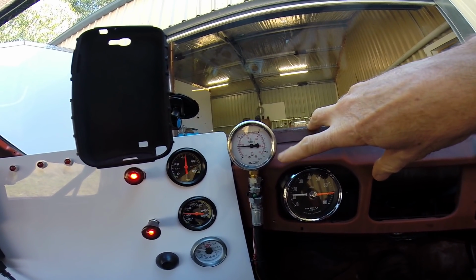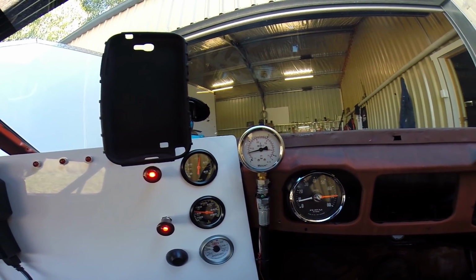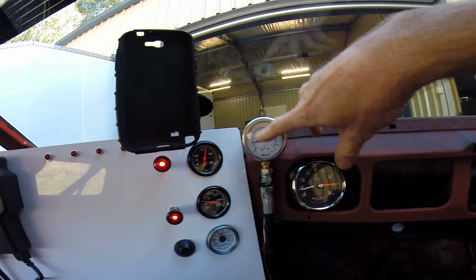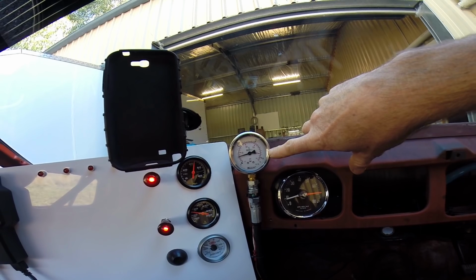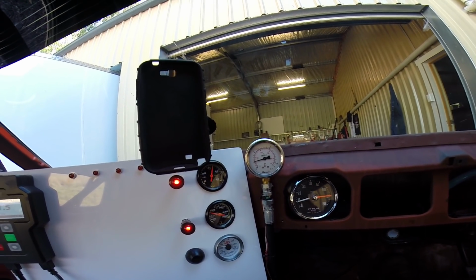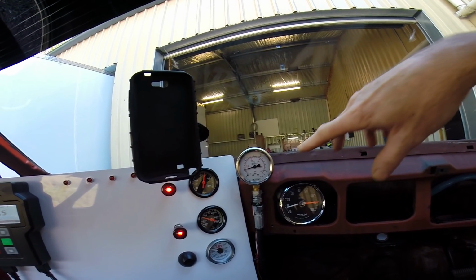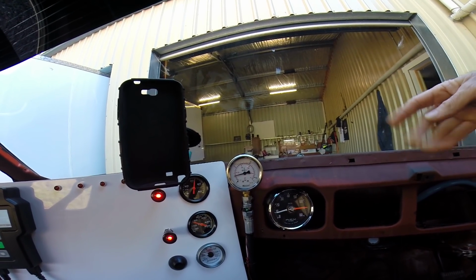See here, guys, when I dab on the throttle, what that is doing is thrusting more fluid through the line cooler out of the transmission, and when you give it that little zap, it's forcing the fluid through, hence rising the fluid pressure. So the idea is, if I can go for a slightly bigger line and keep that line pressure down, because that's what causes the thrust with the converter into the engine. It causes all the issues. So I'm hoping if I can really rectify this, and to be honest, it creeps past 50 a little bit with this engine, but if I can even have it so it doesn't go any higher than 50 psi, it's not going to cause an issue.